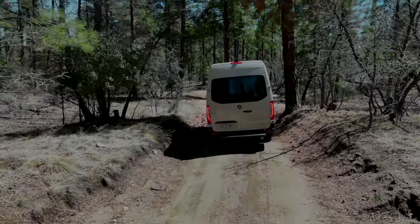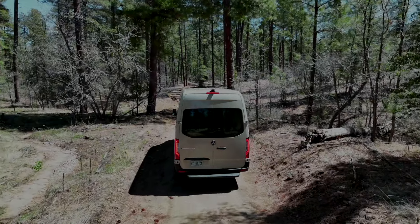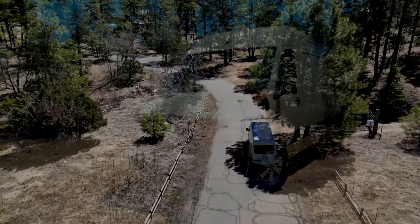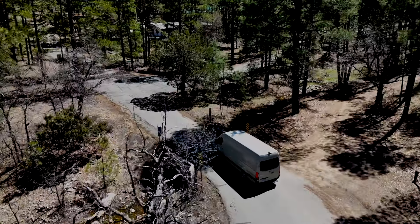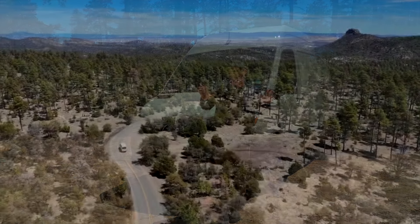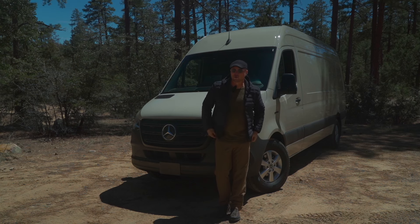So far, this is a much more spirited driving van than we normally experience with the diesel or gasoline variants. It feels like it has good acceleration and it's very smooth because it's not shifting. The overall driving experience on the road is actually quite good. I noticed it has paddle shifters — I thought, what are these for? But they repurposed them: the minus paddle goes into max regen, the right one goes into regular drive mode, and clicking it one more time loosens up the regen. So if you're coasting down a long road and don't want the vehicle slowing below the speed limit, you can adjust the amount of regen with the paddle shifters. That's really clever.